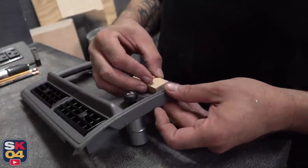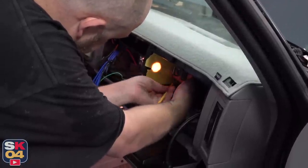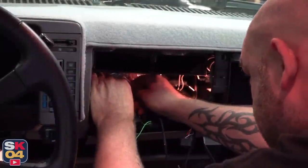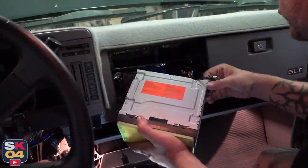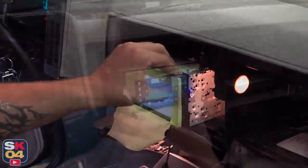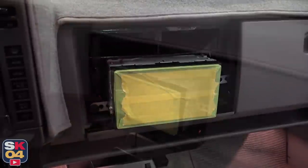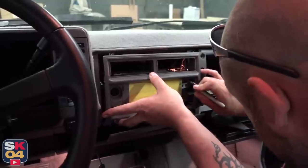Instead of just hacking away at the glove box without a super precise fit for that button, Ben actually cut a small square of wood to fit in the factory opening and used it as a stencil — drilled some pilot holes, cut it out, and the button fit perfect. With that out of the way we connected all the wires to the radio, double-checked everything works properly, and then got the plan together for how we're going to mount this thing. The display spans seven inches — it's a capacitive touch glass screen, very much like a smartphone with a small chrome outline. There are actually no physical buttons; you have some buttons off to the left but they're all blended with the screen. The next step involved making a set of suitable brackets and getting the radio centered in place — it fit perfect between the ductwork for the upper air vents and the framework for the storage tray beneath. Once everything was screwed down it was as tight as can be; that radio is not going anywhere.